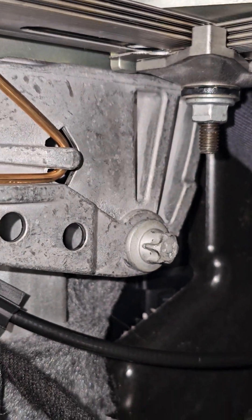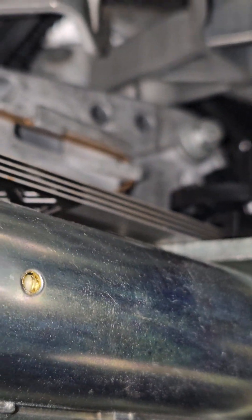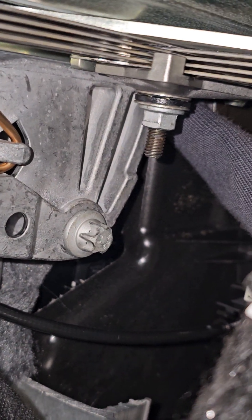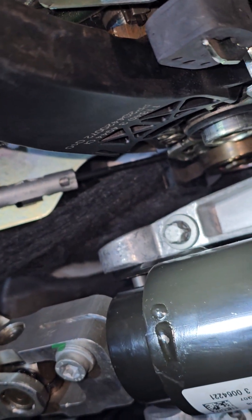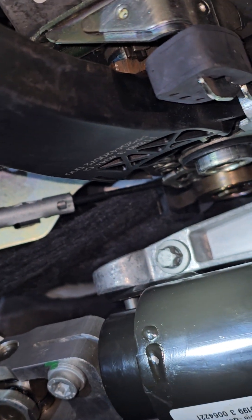It's going to be difficult for me to show you, but there's one and there's the other. All you need to do is slacken those bolts off — this one with a knuckle joint on the left, and this one you can get a ratchet in there, a 3/8 ratchet with a T12 socket. Don't undo it all the way down, just take it down and leave about two or three threads present in the bolts. Do the same with these two bolts but you remove them completely, and what you'll find then is that the whole steering column is moving around, back up and down.